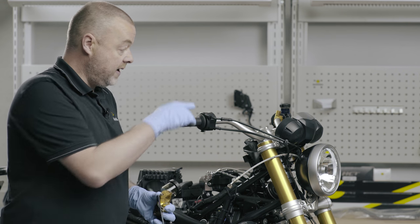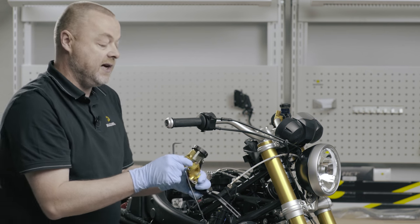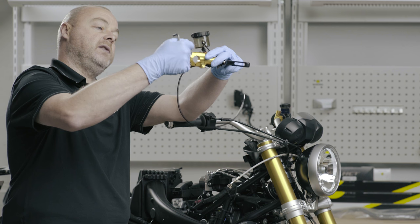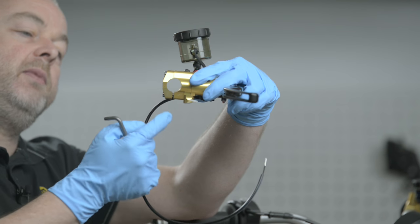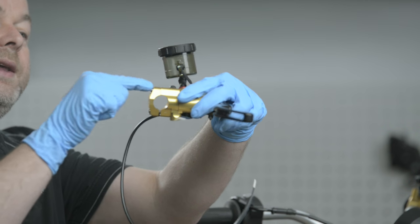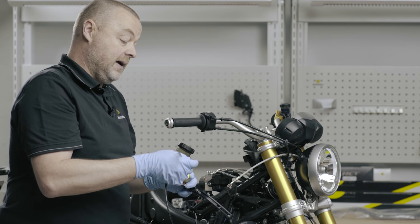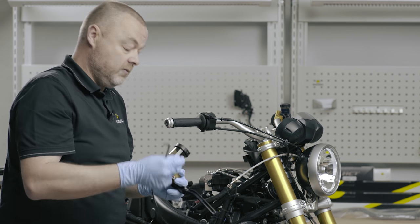In the case of the R9T, I need a mirror clamp rather than the standard clamp — that's an optional extra which I've had to order separately. On the clamp of the HC3, I'm clamped tight against one side of the master cylinder at the top, and I have a gap at the bottom — the gap is the clamp. So I tighten it completely tight against the top and then clamp it at the bottom. The clamp retaining bolts in the HC3 are titanium bolts.